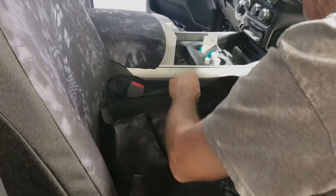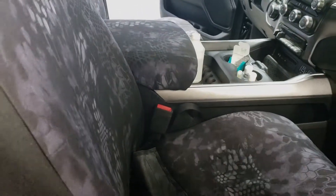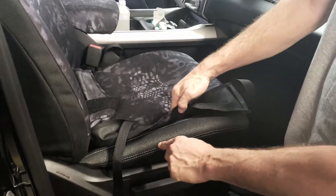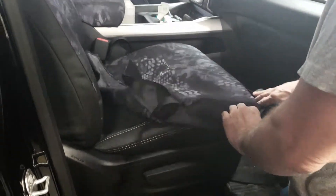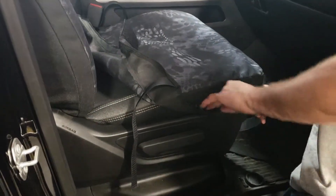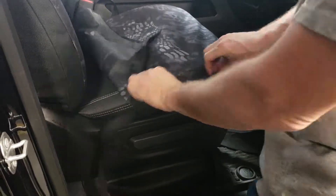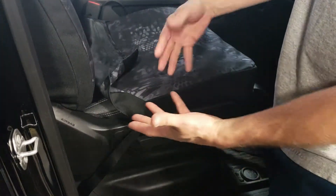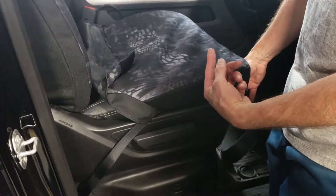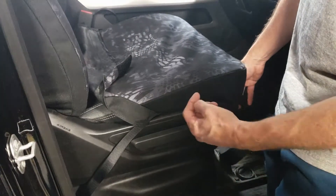Place that on and, just like all the rest of the seat cover, line up the seams of the seat cover to the seams on your seat. Tuck it behind the plastic here. Use extra caution when reaching your hands underneath the seat and routing these velcros — everything under the seat has grease on it, and every metal edge underneath is really sharp.